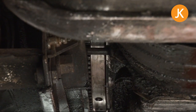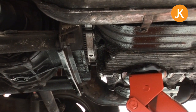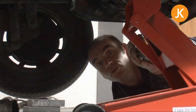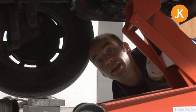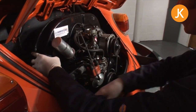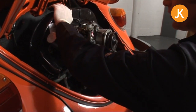There we go — we're in the first portion. You can see the teeth from the bottom of the flywheel have gone in. Now I can pump the jack up a little bit more, and I want to bring that engine more horizontal. I've taken the jack up a tiny bit more, a few more centimetres. It's more parallel now. What I'm going to do is go upstairs, put my hand on top of the fan housing, using the other hand on the exhaust to guide it, and maybe my knee against the trolley jack — we're going to push the whole thing forwards. It might possibly need a bit more jacking up, but we're almost there. Just a quick visual check and maybe a little poke around, make sure nothing's catching down here with the seal against either the exhaust or the engine tinware. Then one hand on the top, one hand on the exhaust to guide.